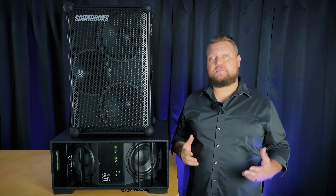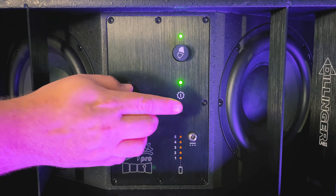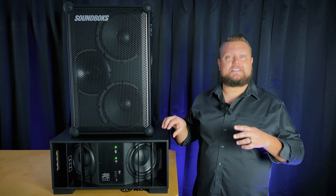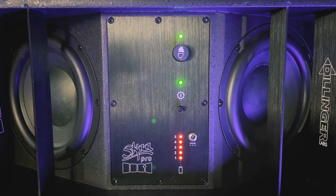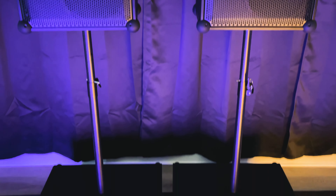One last step that's optional but highly recommended is to double tap the power button on the DFB, then turn the bond button, and this will allow you to select one of six different EQ presets. The DFB has a Soundbox EQ profile tailored for use with Soundbox speakers — this is EQ preset number three. Make sure the LED for preset three is lit up, then either tap the power button once or wait 10 seconds to go back to normal operation. If you have more speakers, just repeat that same process on each additional Soundbox or DFB.